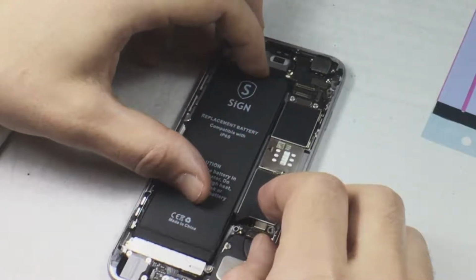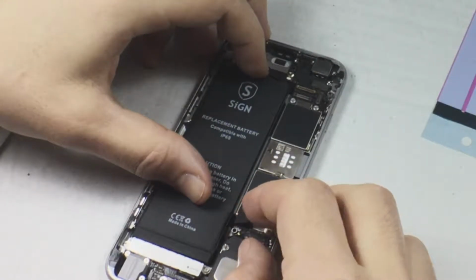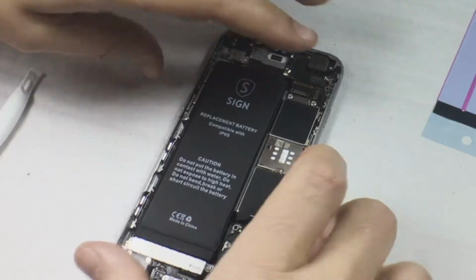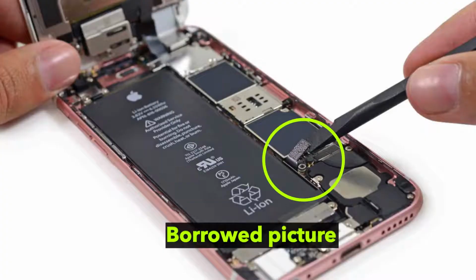Wasn't that hard. Just put down the battery, made sure to line it up, looked at it first without the strips. When you've placed down your battery on the strips, the connector needs to line up properly with the connection so that you're not kinking the cable or anything, because it's a really thin, brittle, flat cable.